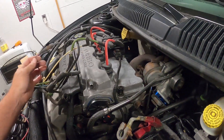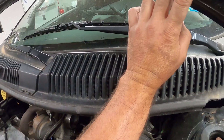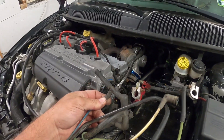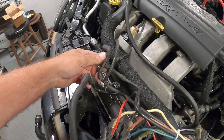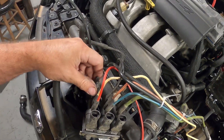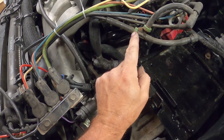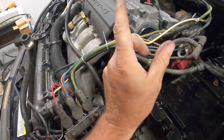The blue solenoid — the pink line comes off of it and goes to the factory surge valve, which is the SAV (surge valve). The blue line tees in on both sides. The black one also tees into the vacuum lines that come off the front. These fittings are basically one-way check valves — they let vacuum flow one way and stop it, similar to how a PCV valve works.